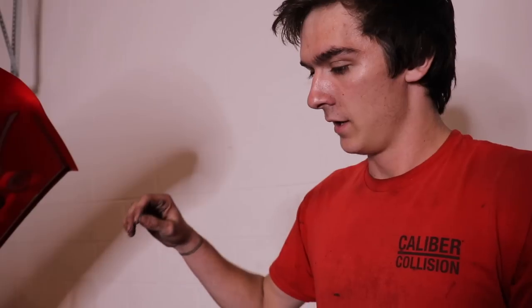Right now we're circulating the intercooler, getting the fluid back in it from a little bit of fluid we did drop when we changed the core back over. I saw a comment in the comment section, I don't know who said it, but somebody asked, did you bleed the intercooler system? This isn't a pressurized system. It's just a pump that circulates, gets flow through it, and it circulates through the intercooler. This will show you the intercooler pump on a 13-14 is actually pretty stout, and it's not a dud. We've checked the actual pressure coming straight out of the pump, and it's flowing the actual GPM rating the manufacturer states. So it's not a dud or anything like that.